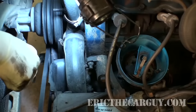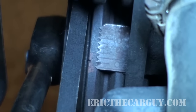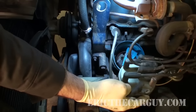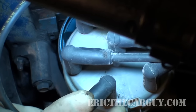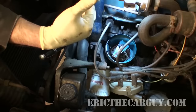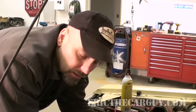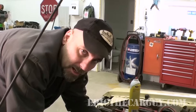There it is — see the mark coming up. I'm going to bring that down to zero. So that's my timing mark, I have it lined up with zero. Now note the ignition rotor over here. You can see the position of the ignition rotor, and the cap is marked — that's number one cylinder. You can see the cap has a number one for the cylinder it's on. That lets me know that I'm on the compression stroke, because the crankshaft also rotates around on the exhaust stroke to this same location. But this is the heart and soul of the test right here — the rotor is lined up at number one and you're on TDC with your timing mark lined up.